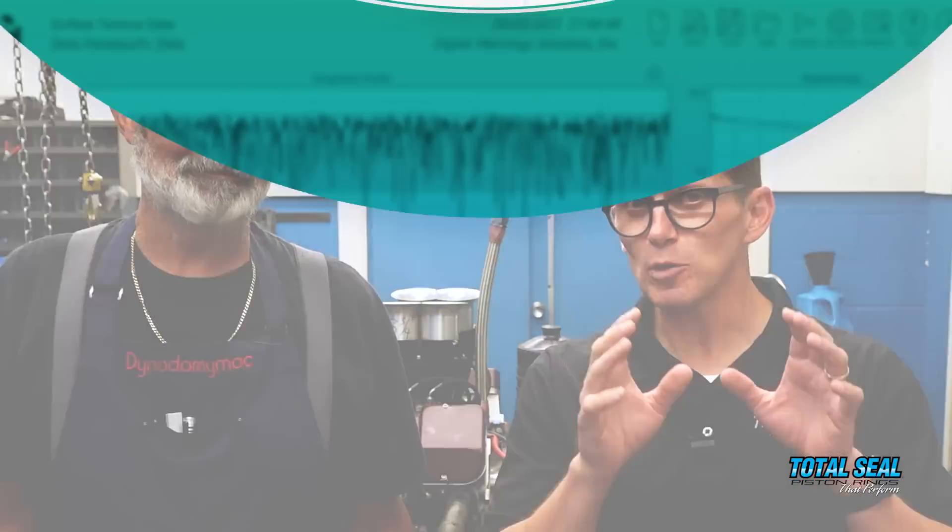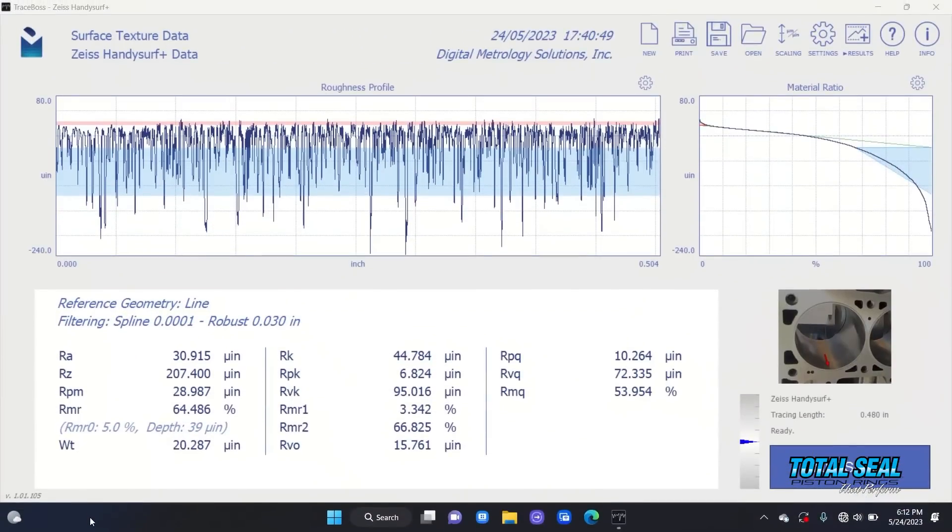The difference was a little more than I had thought. We've got to thank Brad Legman — he really helped us on the finish and the exact bore sizes we needed. I gave him specifications of minus zero, plus two tenths, and literally his bores were closer than that. It's better to have Brad adjust the bore size to get the piston-to-wall clearance versus trying to adjust the pistons. Brad nailed it on the size and the finish.